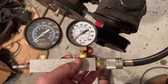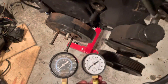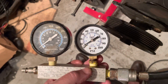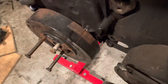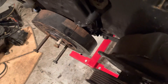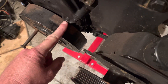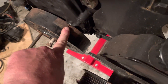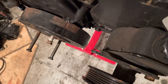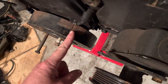So I'm about to test. The customer told me that a mechanic said number six cylinder had zero compression. This is a small block V8 — still not sure if it's a 5.0 or 5.7 yet. So I'm checking number one first. This mark here lines up when number one is top dead center. I rotated the engine and had my finger in the spark plug hole on number one — I felt it try to push my finger away as the mark approached, so I know that's number one on the firing stroke. That's where you do your leak down test. The firing order is 1-8-4-3-6-5, and one and six are opposing cylinders, so I'll rotate 360 degrees until this mark lines up again and then test number six.